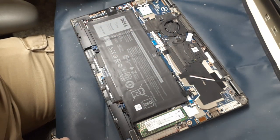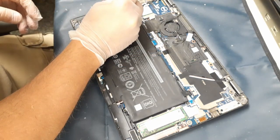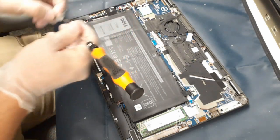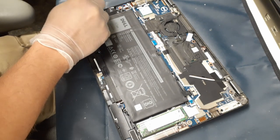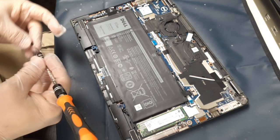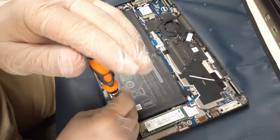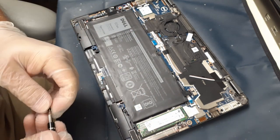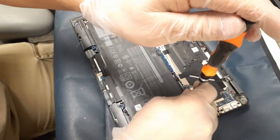Make sure to put all those screws back into the battery. After that, it's just finishing the reversal of what we did — you're going to put the back panel on the exact opposite way we took it off. Put the bottom on first, or the section away from the hinges, and then rock it down to the hinge section so that it snaps into place properly.